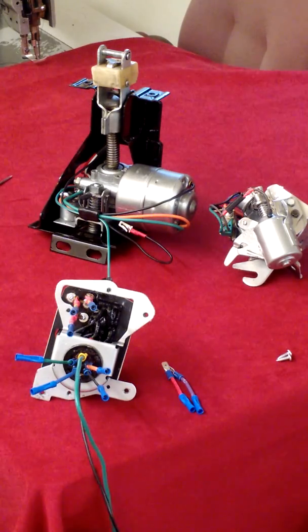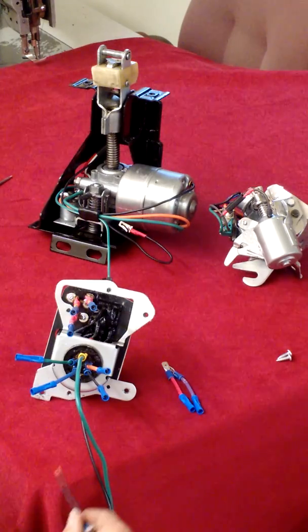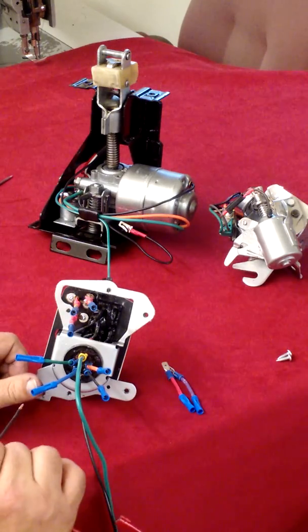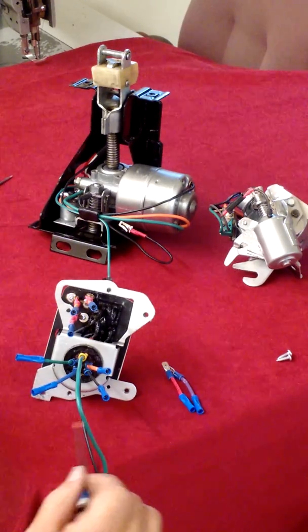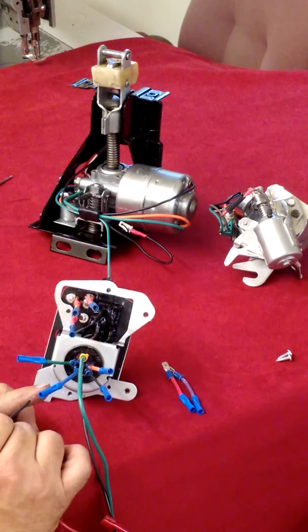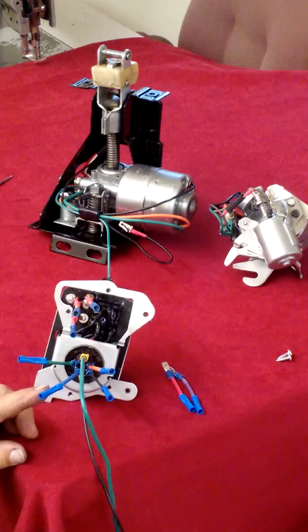of the car where you turn the key at the trunk lid, or from a button in the glove compartment. So what we're going to do is actuate the opening system, and we're going to send a momentary pulse of power, which is what would happen when you either push the button or turn the key to energize the opening circuit. And you'll hear a relay click. That was the relay clicking.